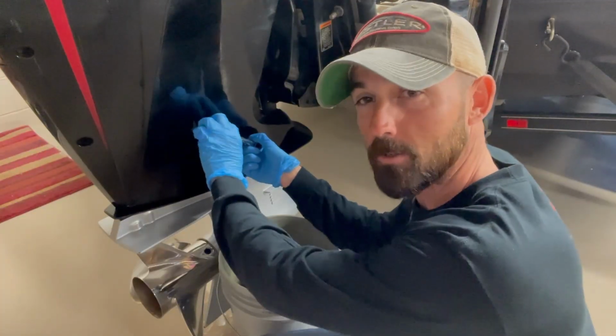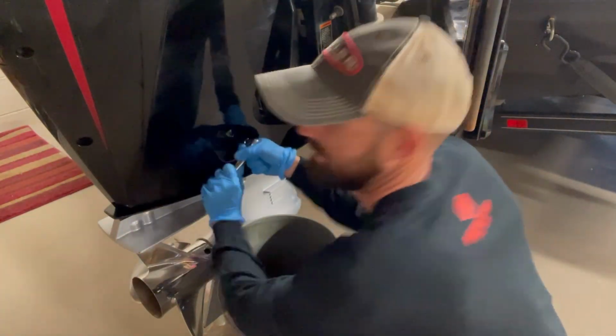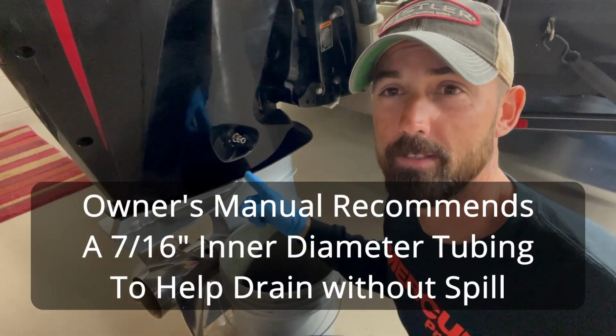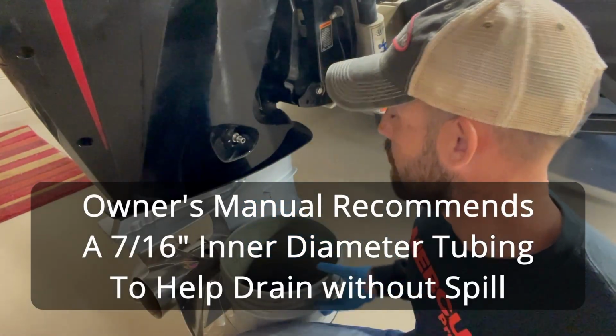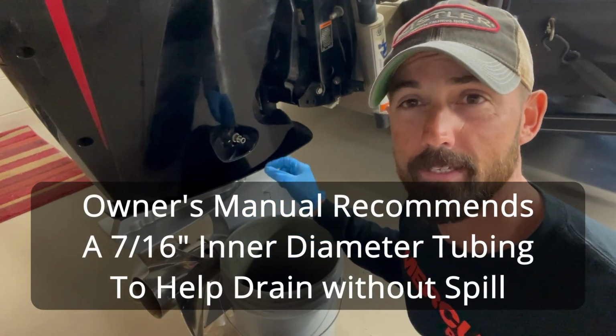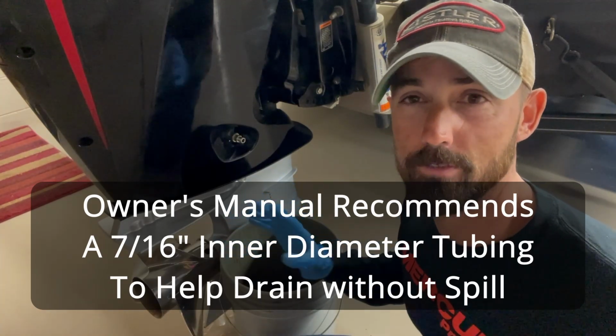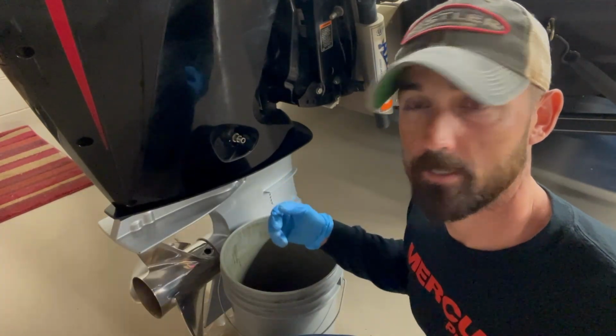We're gonna turn it counterclockwise. It's probably gonna be a little tight. There we go. We got a little turn. And notice no oil is coming out yet. That's kind of by design. So now I can loosen this with my hand, and you don't want to over loosen it. No more than a couple of full turns would be over loosening. So don't do that. But you'll see oil start to come out of here.